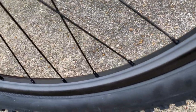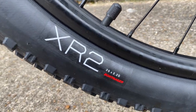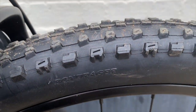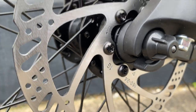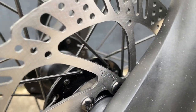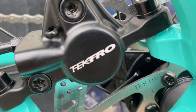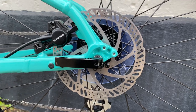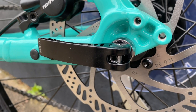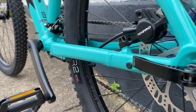Yeah, 26. Those are 26-inch Bontrager Connection rims, double wall alloy, with XR2 tires, 26 by 2.20. 26-inch wheels means less rolling mass, but it does get the same brakes — Tektro hydraulic HDM275s, disc front and rear, both rotors 160 millimeter. Hubs are both Formula: at the rear, a DC-22 with 135 millimeters of spacing and a quick release; DC-20 up front, also with quick release.